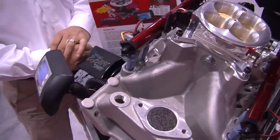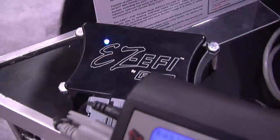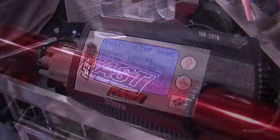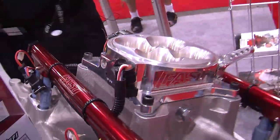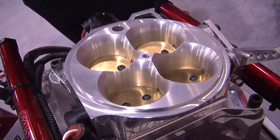The need comes in because, say for example, you've got an 87 Mustang with an EEC4 5.0 system. That's a pretty basic system that is kind of tricky to tune — it doesn't have wideband O2, doesn't offer today's features. But you can now upgrade to the EZEFI brain and ECM, and this includes a new harness. A wiring harness from the 80s transplanted today is a bad idea because all that stuff is brittle, it breaks, wires are in poor form.